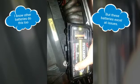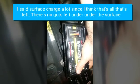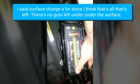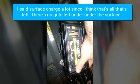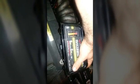You can kind of tease the charger back and forth, hit it with six amps — look, 50%. I know it comes down a little bit as surface charge builds and fakes out that it's got a lot of charge left, but I'm just wasting my time with this battery. Even if I can get it to run the car, at best it's an emergency battery, because it's going to crap out anytime — charging all day here, an hour or so here, and it's down to 50% again just because I walked in the door. It would be a better example if I had the key to prove my point — if the car started once, we couldn't start it a second time.